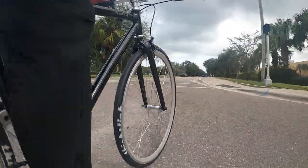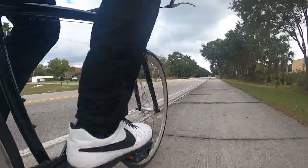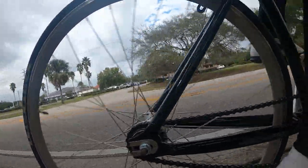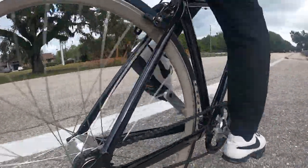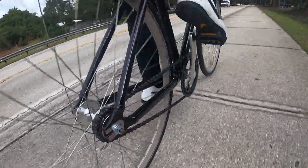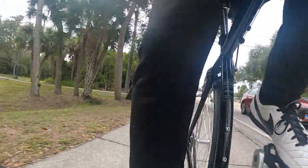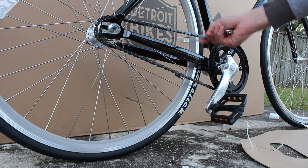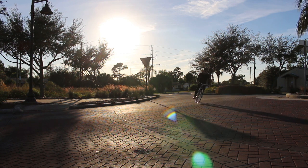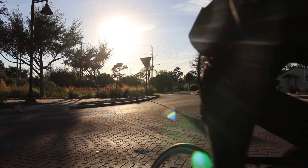One small complaint: there is a little bit of noise coming from the drivetrain, somewhere around the front chain ring. I think the chain is occasionally touching the chain guard under certain conditions — just a tiny little rattle. I tried picking it up with my GoPro and couldn't even capture the sound, so it's really minor. If you watch my unboxing video, you can see me push up on the chain and say maybe it's even too tight. Well, it turns out it loosened up a lot after four or five weeks of riding and is now probably right where it should be. So if you get this bike and the chain seems a bit too tight, I'd recommend just riding it a bit and hopefully it will loosen up like mine did.